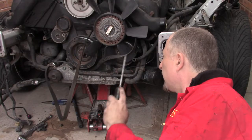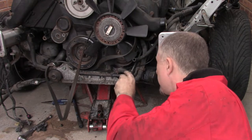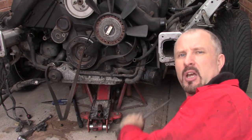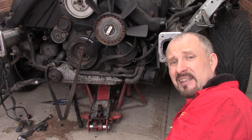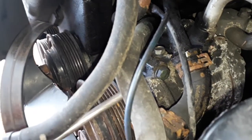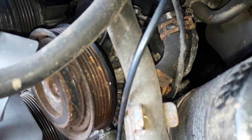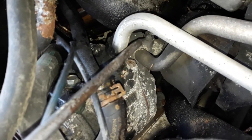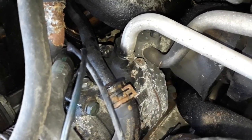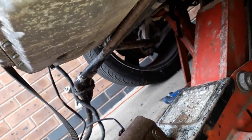I think I might have another go at this air conditioning pump. I'm going to undo a couple of bolts in there and I think I might be able to drop it down so I can undo these hoses. It's pretty tight in there. If I undo this bolt there and then there's another one there, then this might just be able to drop down enough so I can undo these two allen bolts and remove the air con lines - then remove the entire lines from under the car. That's the plan anyway.